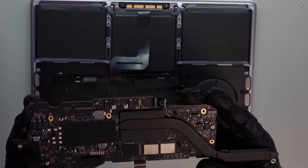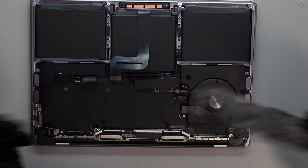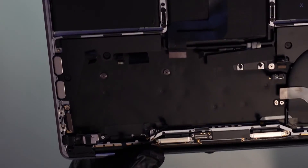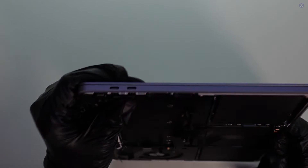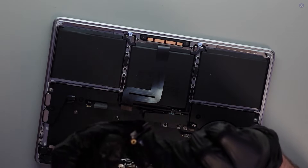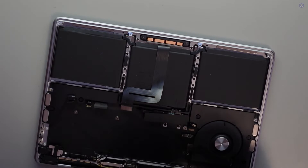We see a little bit of corrosion in some areas. Always, if you see liquid damage, this is a very obvious area. You always take a look at the top cover to see possible damage. There's a little bit of blue here close to where the Wi-Fi chip is — probably a little bit of damage or corrosion near the Wi-Fi chip. Since it's an open gap, liquid can go through. Also, the port is an open gap where you plug in and charge — and you can see that it is actually corroded as well. Let's take a look under the microscope — this one obviously needs to be replaced, and then we'll look at the damage on the logic board.